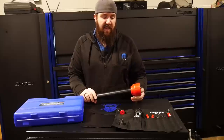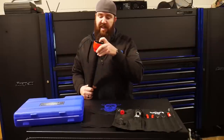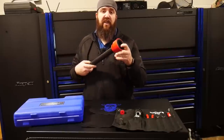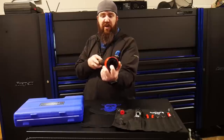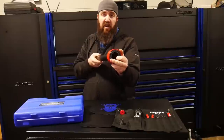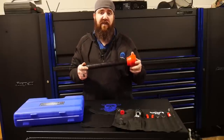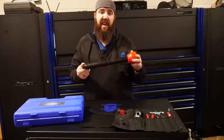This thing is fantastic in just about any place you can get it to. All of the tie rods these days have rounded ends — they don't have that nice nut end that they used to anymore. So having that one-way locking clutch tool makes it really nice. This one doesn't just do the single direction; this one will work for tightening as well. All you have to do is put it on there. The one-way clutch locks it into place as you start to turn it, you turn it a little bit harder and it locks. Break your tie rod end loose, and when you're putting it back on, twist it a little bit harder — it'll lock into the on position and you're able to tighten it up. This is a great tool to have rather than trying to get a set of spanner wrenches into those subframe areas.